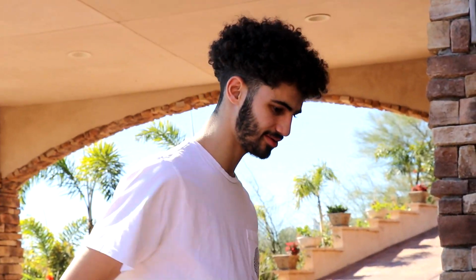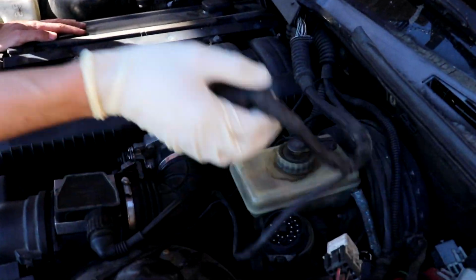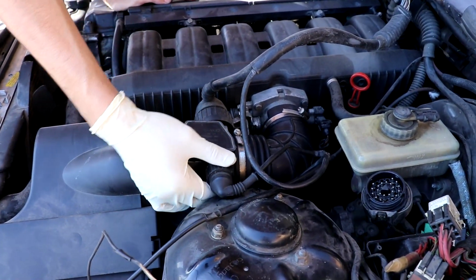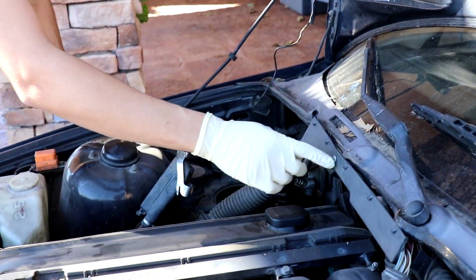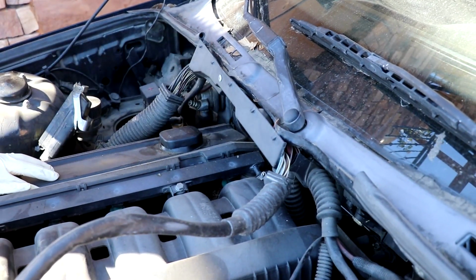All right, so we're gonna start by disconnecting big wires and stuff. I think this is a C101 or C109. Go ahead and disconnect that. We're gonna disconnect the MAF. These are just twist off. Cool. You're gonna disconnect the ECU. Take the self tappers out that the previous owner put in, whenever you get a chance. And that's gonna be the wiring.